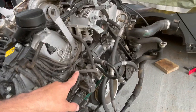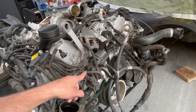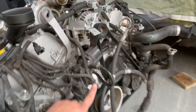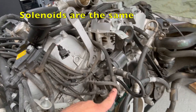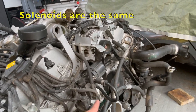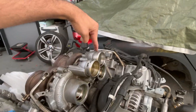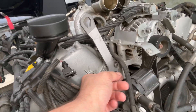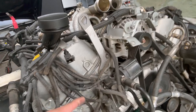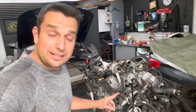The vacuum comes from the small canister or reservoir on the bottom. It has a T-piece — this plastic T normally perishes, so it's very common to find them cracked or leaking vacuum. From here it separates and goes to the front or back of these solenoids. Then another small hose connects where the solenoid opens and closes the vacuum flow — this one goes to the actuator of bank two. And this one — which is, by the way, really perished, see how cracked and dry that is, it was supposed to be rubber — is for bank one.